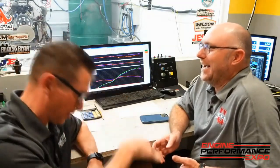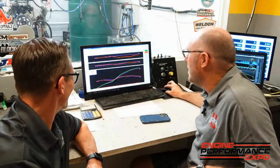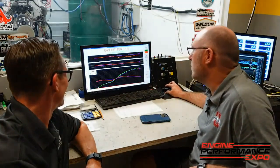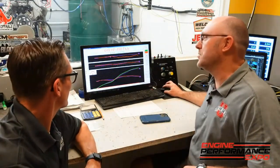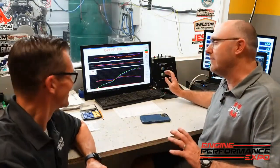Well, that was interesting. So exactly what you'd expect — well, not really. I held my breath there for a second when the oil pressure was doing this. I was watching it, but it sort of stabilized. We're in there and it dropped down to about 35-40 pounds, a lot less than the 75 or 80 that it was before. So it took a nosedive and I had my finger on the throttle just in case, but it leveled out. It was okay.